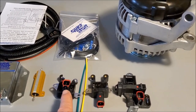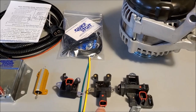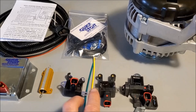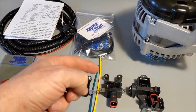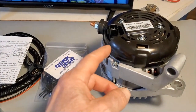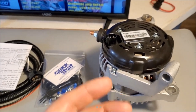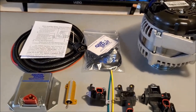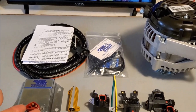Both the ERCK FRM 071 and the ERCK FRM 081 are Denso type units, and the brush holder actually attaches to the back of the driver. When you change the driver on this type of unit, you have to transfer the brush holder assembly from the original driver to the new modified driver and then put those back on. With each kit you're going to get the heavy duty wiring harness with instructions.